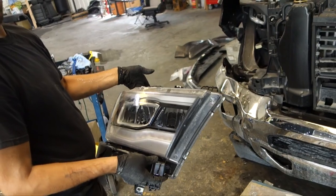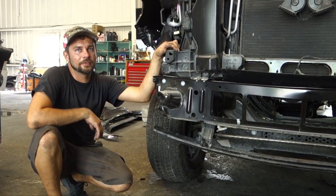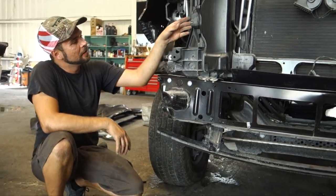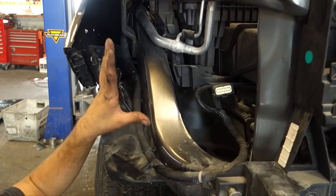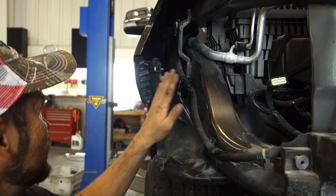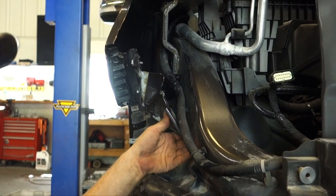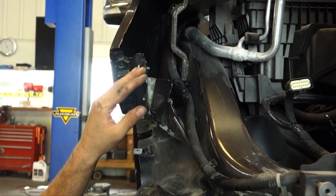Just like always on the pictures, you can't see everything. There are some hidden damages, and probably not the smallest of hidden damages. The first one was obviously the headlight - it looked like it was completely intact, but basically the whole housing is destroyed. There's this bracket - even though the fender looks like it's okay, this whole bracket is messed up. Luckily, it just unbolts from underneath here, so we can just replace that and probably straighten this out instead of having to do the whole fender.